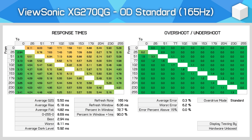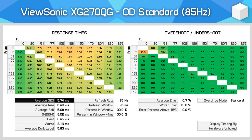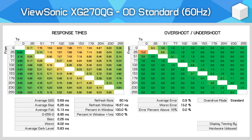How does the standard mode hold up throughout the refresh rate range? Very well, although performance isn't perhaps where it could be. At 144Hz we're down to a 5.77ms grey-to-grey average, then 5.82ms at 120Hz, 5.79ms at 100Hz, and 5.74ms at 85Hz, before settling into around 5.7ms at 60Hz — all with no overshoot. So we're consistently getting between 5.5 and 5.8ms grey-to-grey numbers with zero inverse ghosting concerns and very decent refresh rate compliance.